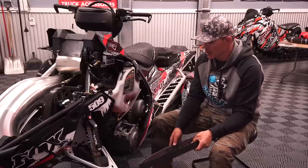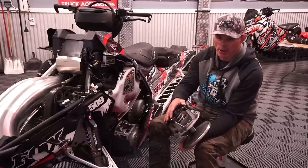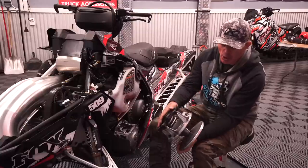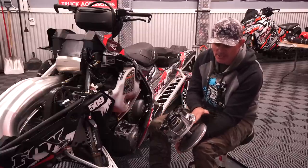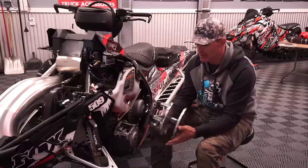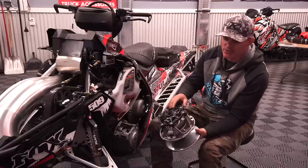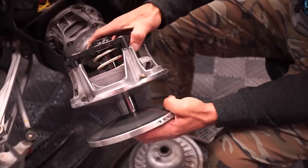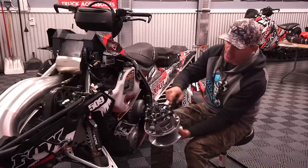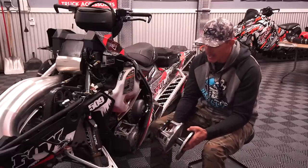In terms of going into your clutches, if you're gonna do it yourself — I've pulled off a clutch from another sled. It's really important that we clean these surfaces. You can take some emery cloth and really clean those up. You don't wanna use anything too abrasive. You can cross-hatch that using the emery cloth, and that'll really help clean up the interior surfaces of your primary. You're also wanting to check and inspect your primary spring. I've seen these primary springs break well inside of the housing.